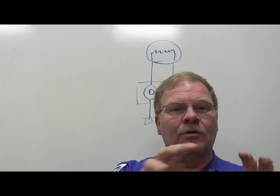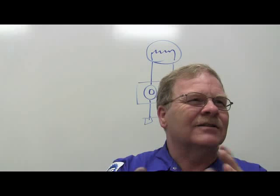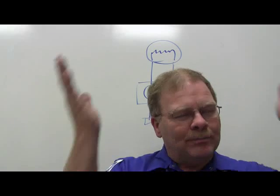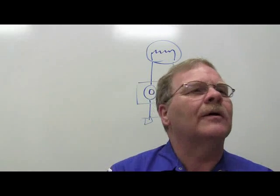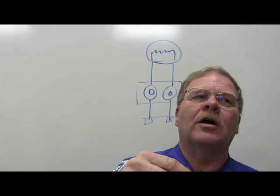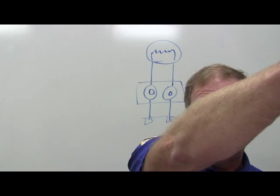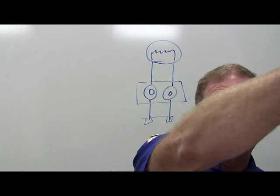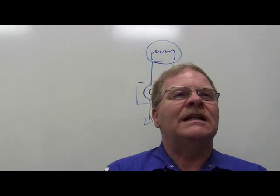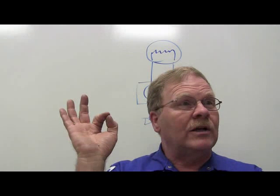Donnie was working on replacing DPFE sensors, worried about the solenoid maybe causing surge. He did all that, and it was still surging. He was beating his head against the wall. And I said, Donnie, don't you remember some of these 3.8s that we worked on would get valve stem seal deposits on the spark plug? They get a lot of that puffy ice cream looking crap on the bottom left spark plug you see up there. That's valve stem seal deposits. If you get enough on there, you'll get a surge that will go away when you unplug the EGR valve.